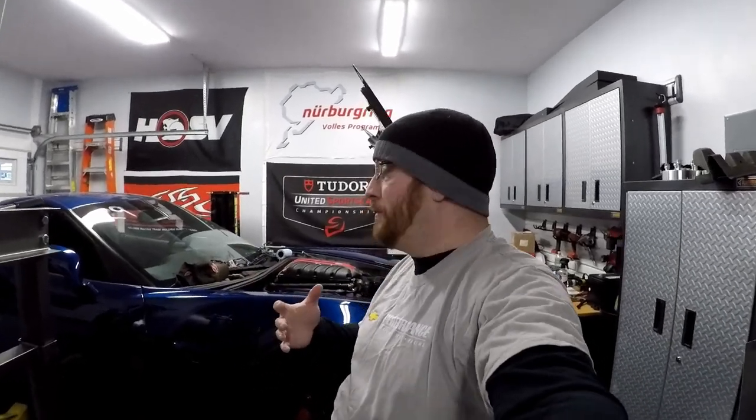So they've been running an air-to-water setup, and he is actually upgrading to an air-to-air intercooler. I think he either tack-welded his front intercooler setup or he bought one and is modifying it to fit his car. He happened to have his air-to-water intercooler pump for sale, and what I pretty much picked up was the biggest pump that you can buy for a positive displacement type supercharger — or in this case a centrifugal — running an air-to-water intercooler setup.